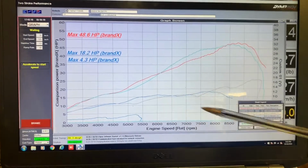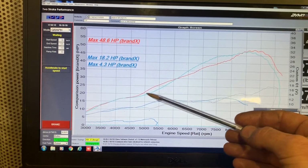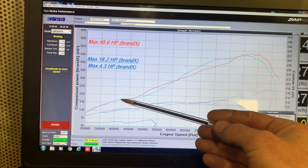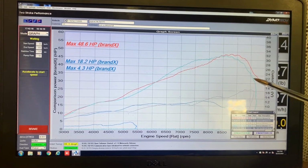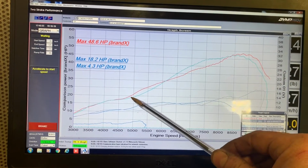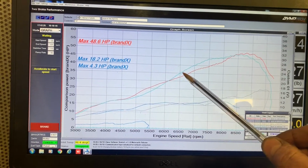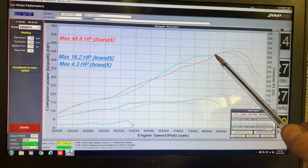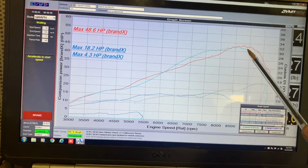Okay, so full throttle, we're looking at the red line, which is the 2020 model, nice and linear delivery, and the light blue line, which is the 2019 model. So again, the 2020 model has a bit more punch between about 5,000 and 6,000 RPM, has noticeably less from 6 to 8.5, and then it revs out a bit further around 9,000.